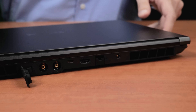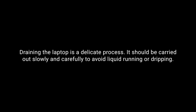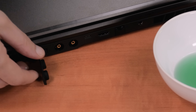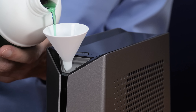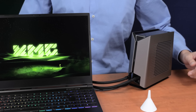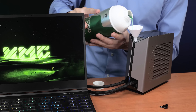While there are clearly excellent improvements with this setup, it's not without downsides. Disconnecting the tubes seems to introduce the biggest issues — there's a small amount of leakage that needs to be wiped off. You need to carefully hold the laptop a certain way and be careful of water dripping into air vents or ports. It's recommended to drain the laptop before transportation. There's a rubber seal over the rear holes so you don't need to remove every last drop, but it's not recommended to keep it full either in case it comes loose in your bag. As disconnecting removes some liquid, you'll need to top it up over time, and there's a narrow window on the front of the Oasis to check the fill level.